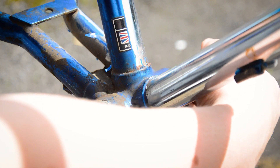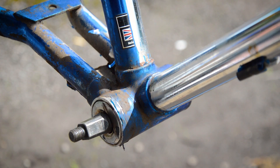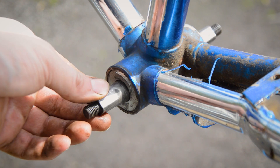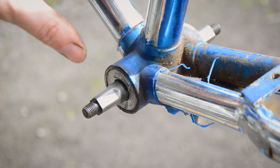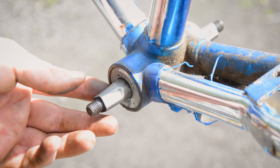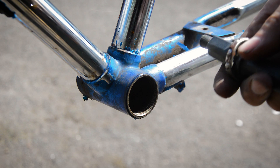It would have worked with a 71mm normal shell. The way you can tell it's a 5-series is that it measures 55mm from this bearing surface to this one. I've just threaded that drive side cup back in, so let's try it — let's put the axle through. As I thought, the drive side cup has gone all the way in and the axle is still loose, so I need to find maybe a 73mm axle from a 73mm mountain bike bottom bracket.